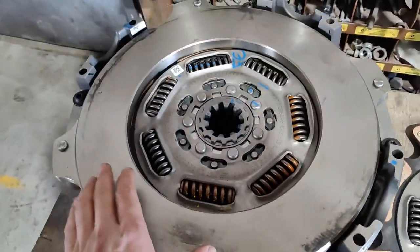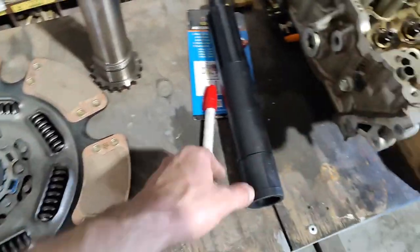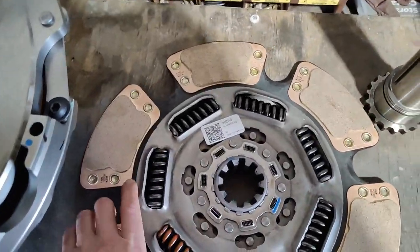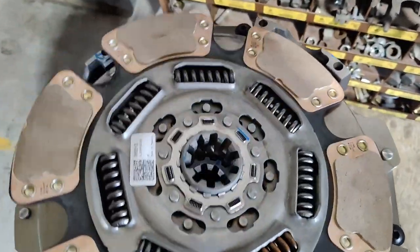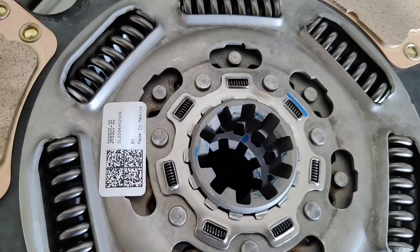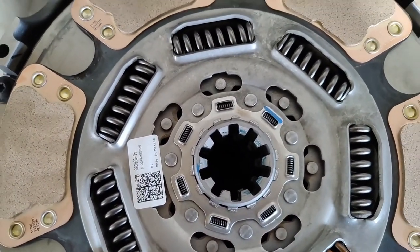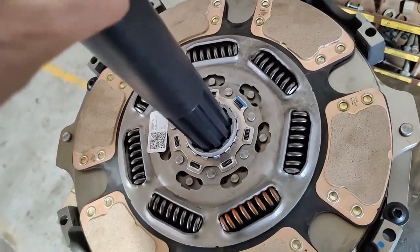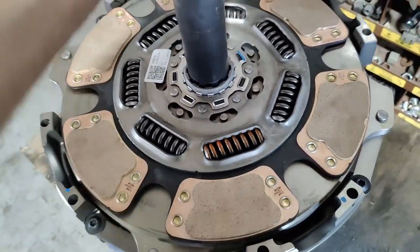This is our new clutch, but to install it back it's better to have a jack — we don't have it. So I bought an aligning tool like this. This tool is used to align the tips when installing the disc on the clutch. It should be aligning the upper tips with lower tips, because if not they are not gonna be aligned and you will not be able to insert the transmission — the input shaft is not gonna go inside. So you can use an aligning tool like this; make sure it goes all the way in.